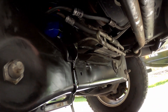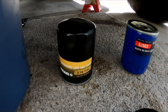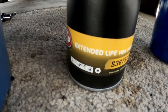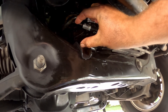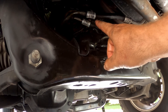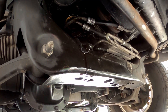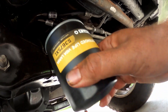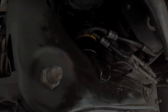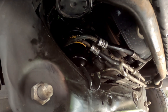That little wrench works pretty well. Now I've got the old filter out and here's the new one — I got the XL Extended Life filter. I had a little trouble getting the wrench through the opening, so I went up and over the tubes and pulled it out above them and it came out pretty easily. Now I'm going to put a little oil into the new filter, wet the ring, and stick it back up in there. After some maneuvering with the filter and wrench over the two hoses, I was able to tighten up the filter pretty good.